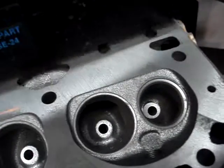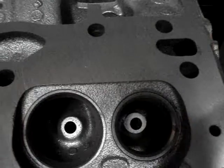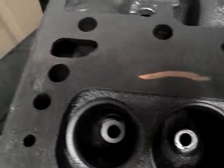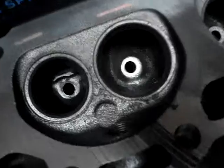If you put a straight edge on it and look at the ends, cylinder heads have a tendency to bow up in the middle. If we look at the ends of this head, there are no markings from the pen at all, but you get toward the center and you start to see high and low spots. Again, at the other end of the head there's nothing — it's all cleaned up. Heads bow up in the middle and tend to have the most warpage there.